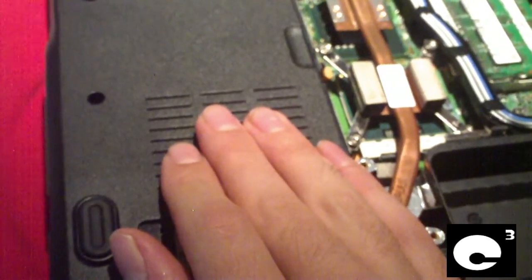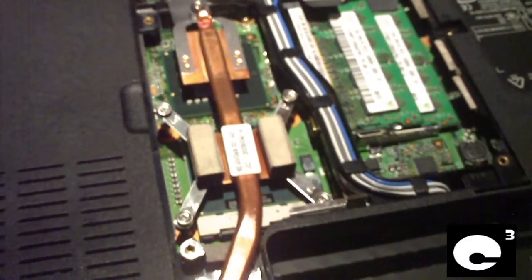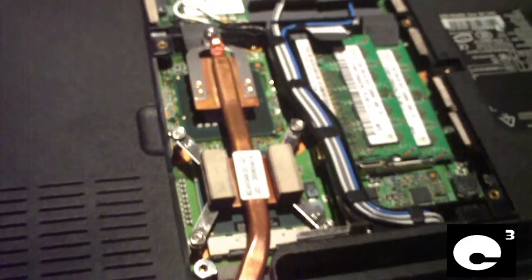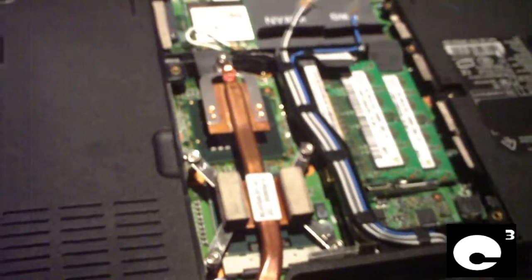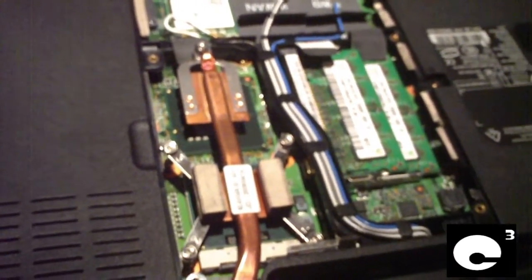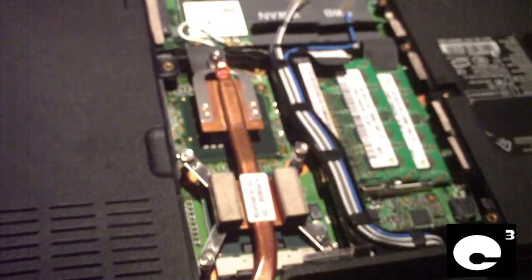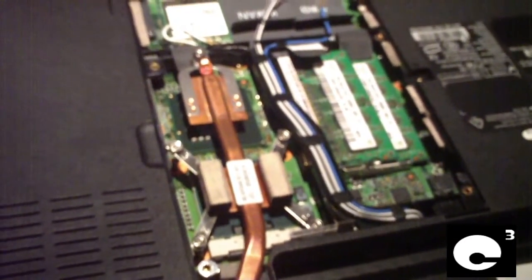Newer BIOS updates set the fan to come on earlier, but there's an even bigger issue with the DV6000 model. In a stock configuration, the heat pipe barely even touches the Northbridge chip die — you can actually see a gap between the thermal pillow and the die of the NVIDIA Northbridge. So the Northbridge just sits there and builds up heat, and nothing is there to dissipate it. The chip gets so hot that it will break the solder loose from the board, giving you loose solder connections. You have to either reflow the board for temporary use, or reball it for long-term reliability.